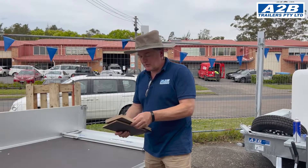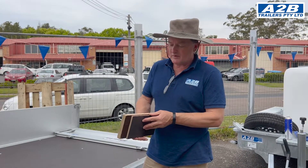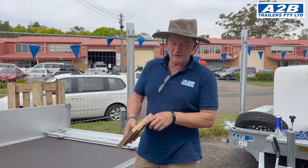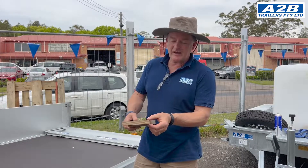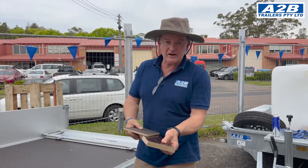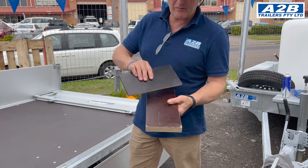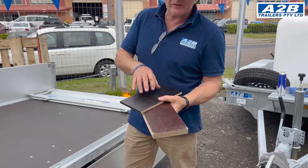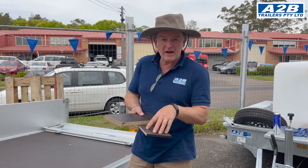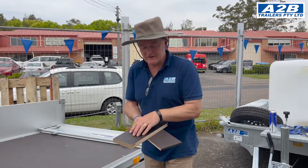The product, as you'll want to know when you're looking at your trailer systems, is a heavy density birch ply which has a phenolic resin layer impregnated to the top and the bottom. On the bottom it's a very shiny smooth surface — you'll know these from shuttering ply, it's a brilliant product for concreting up. On the top side you'll have an impregnated net which gives you the slip resistance in the product.